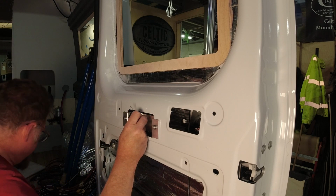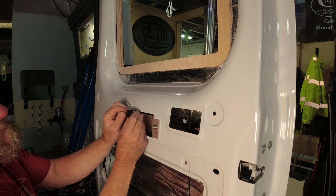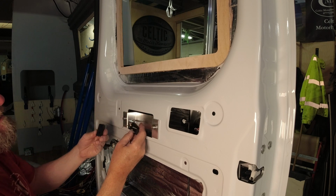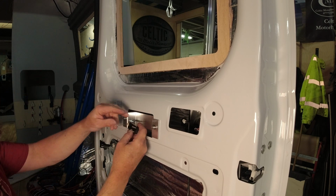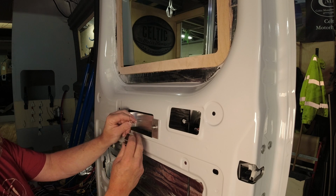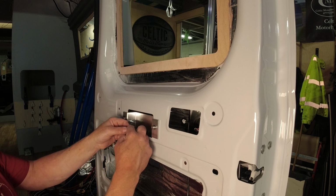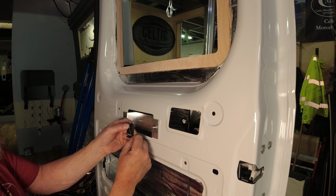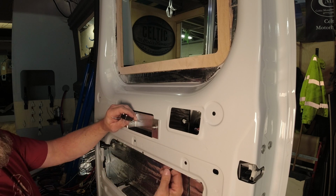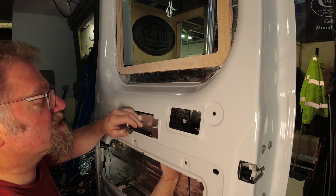This is probably the fiddliest part. The bolts are quite small. And then when we pull that off, you can see you've got the solderless nipple with an Allen key on the top. It's a 2mm Allen key, I think. We're going to make sure this cable stays in this channel. We're then going to put the original cable into the slot.